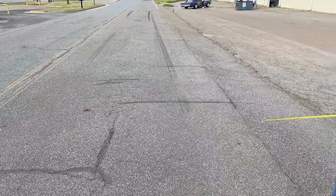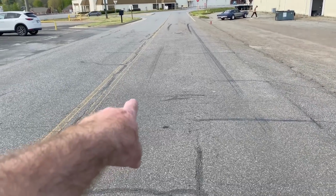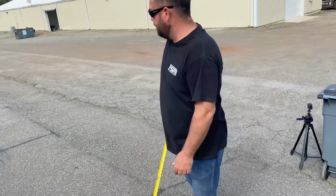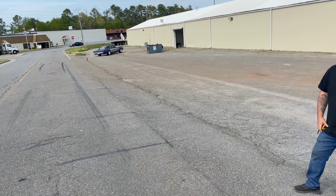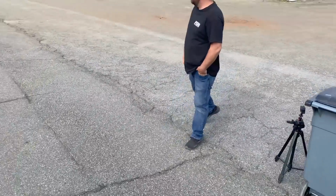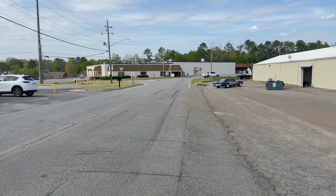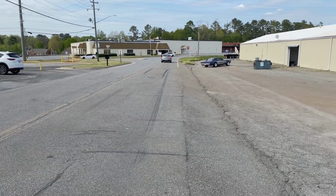So this is your old mark. I can't tell, so I'm going to assume you started here. These outside ones are the new ones. Those were there before, so it's hard to tell. So there's no marks to really guide this time. The thing about driving it this time is you start laying into the brakes and it's just slowing down. It's not locking up. So I just kept pushing harder and harder, and then at the very end they lock up, but not throughout the whole deal like before. This is why you're not stopping. When you're skidding, you can't steer and you're not really stopping effectively. So this is way better. Same tires, drastically different performance thanks to the Wilwood brakes and the QA1 suspension.